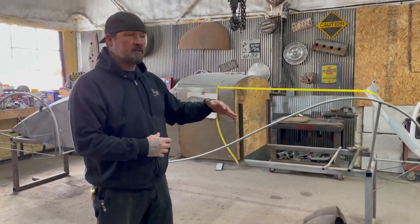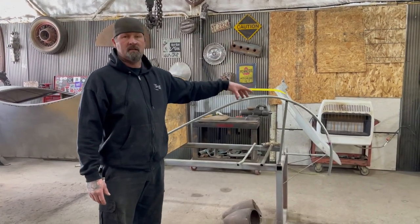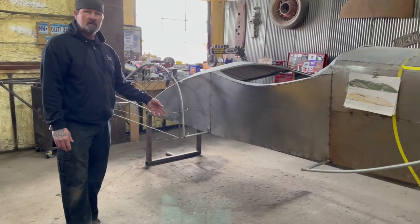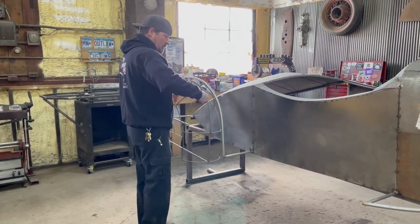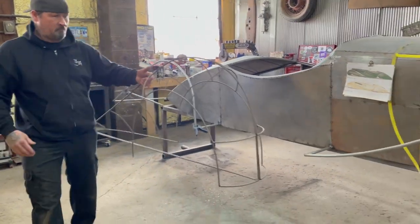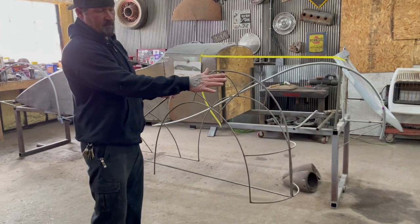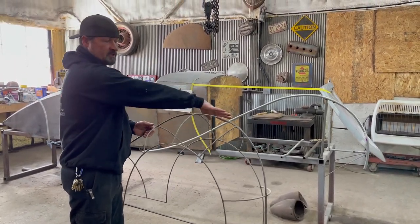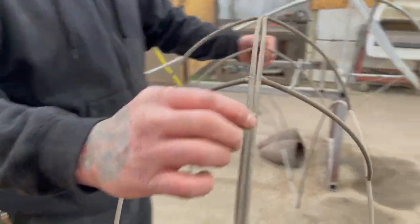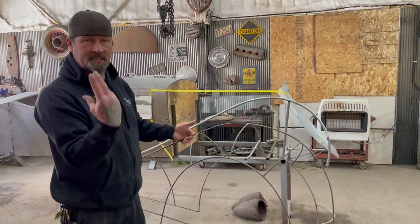The reason I'm showing you all these little steps is to show you what it takes to do something like this — first using the conduit to get the shape of the car, and then the next thing you do is the wire-form buck. Here's the wire-form buck I started with for the fenders. What you're looking at is the right-hand passenger side and the driver's side. I have both these fenders welded together so I can split these welds and have two fenders that I'm building at once — both sides of the car at the same time.